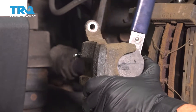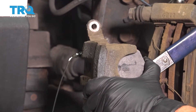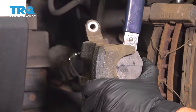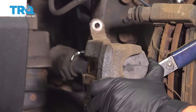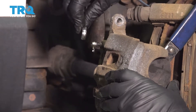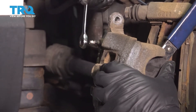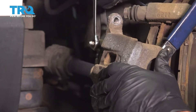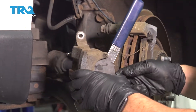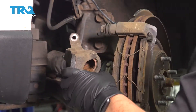There's no restriction — I'm not forcing these pistons back. They go back nice and smooth, and that's what I'm looking for. I'll examine the caliper boots to confirm that there's no liquid coming out around the seals. So we'll be good to go and no caliper will be needed — we can do just a regular brake job. Now we'll close that back up, and I have a caliper hook to hang the caliper up out of the way.